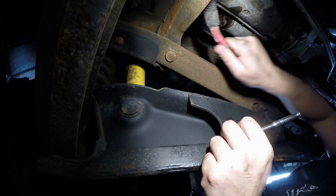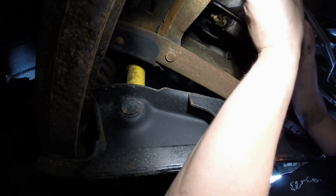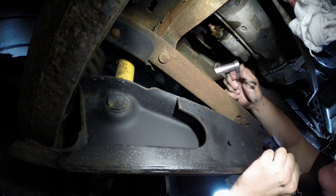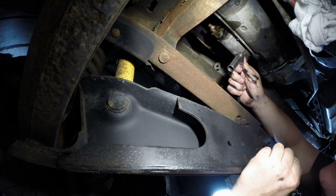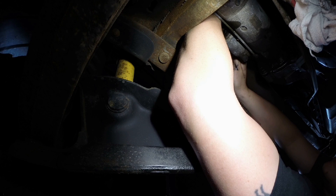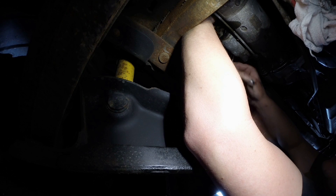Now that the wires are off, I take them and press them against the cooler lines and the pan. Just in case of any accidental connection up top, I wrap them also. A flex head ratchet with a 13 millimeter deep socket will be your best friend on these. Like I said, these usually aren't in too tight. We definitely want to get that top bolt out first — I have them pre-loosened — and we'll just get it out of there.